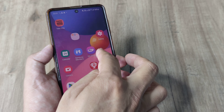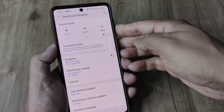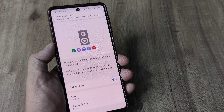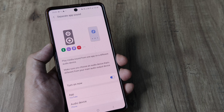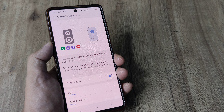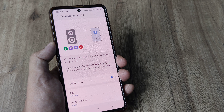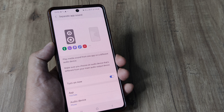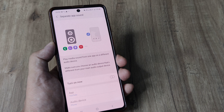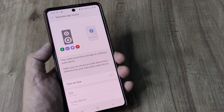There's one more thing I'd like to suggest: head to mobile Settings, then to Sounds and Vibrations, and ensure that the volume is turned up to the top levels. It should not be muted, because if your phone is muted it's obvious the speakers won't work. Scroll down until you see Separate App Sound. Tap on it and make sure it is not turned on. For certain applications, this setting tells the phone to play sound on a different device, which can create conflicts in the OS and the speakers don't work. I advise simply turning it off — when it was turned on, my music was playing through some other device or the car speakers rather than the phone.